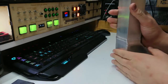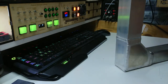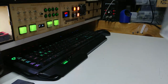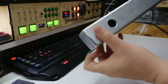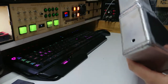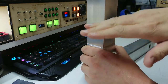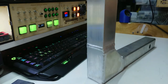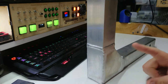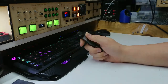Because it runs down like this, I can fit a little pad here for the main tube to rest against, reducing some stress on the outboard tube. The original design had a single gusset — we've now switched to a double gusset. This is all capped, but in case you're wondering what happens if it gets full of water, we have a drain hole here as well. Even though it's sealed at the top, the water level could conceivably push up in there.